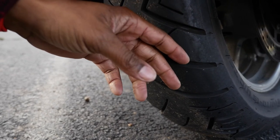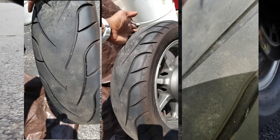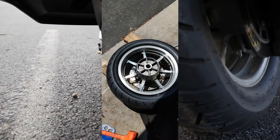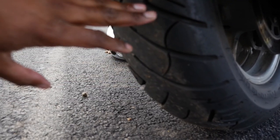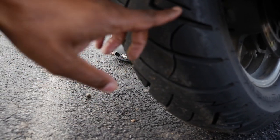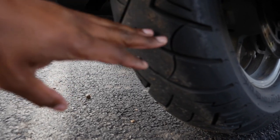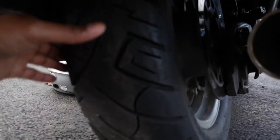You're going to get a little bit of that flat spot — I had that with the Commander 2s as well. I got 19,000 miles out of the Commander 2s, which was great. My only thing with them is they have a hard carcass, so you get a stiffer ride and end up having to soften up the rebound on your shock if you have that ability. I have the progressive shock so I have that ability to soften the rebound.